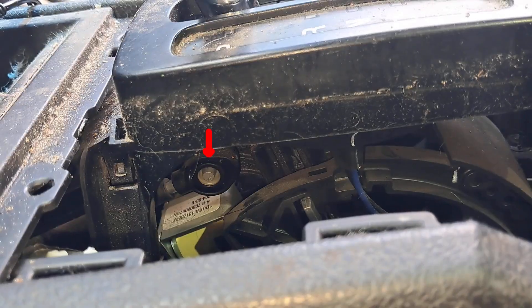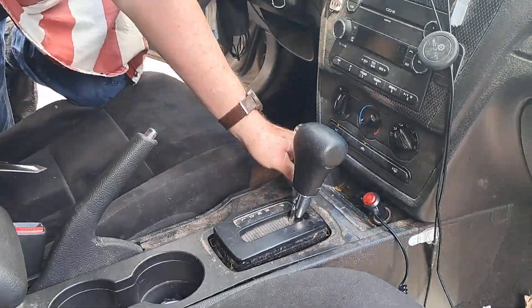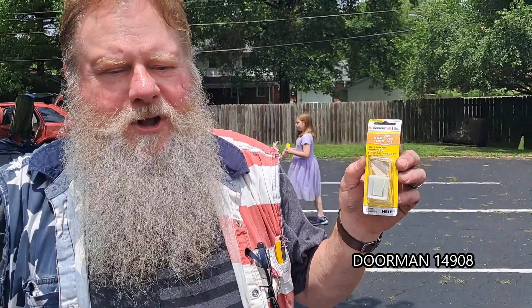There are just a few things that can go wrong in this situation. The cable could break, there's a bushing on the shifter itself, and there's a bushing on the transmission connecting it to the cable. I initially started out by removing my console where my shifter is and checking the bushing that connects it to the cable, and it was fine. I came out here, raised the hood, and looked down inside, and lo and behold there was my little bushing just stuck up waving at me. I went to O'Reilly Auto Parts and got a Dorman replacement bushing.